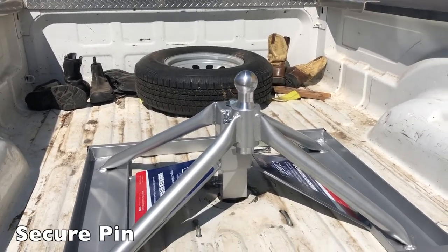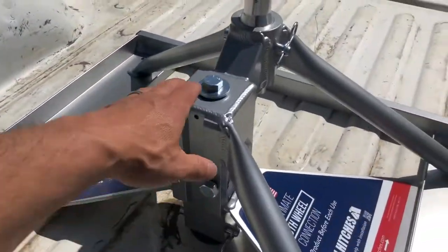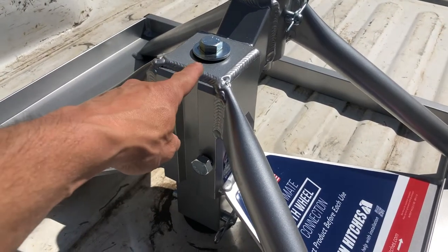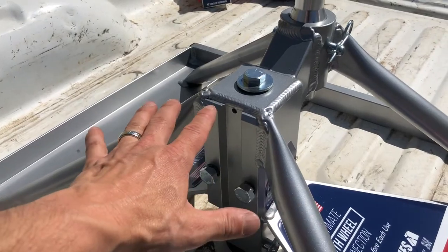Now that we have this together, there are a few bolts to tighten — this one on the top and these two in the front. These are the ones that secure it up and down and stop it from moving. This is the one that tightens tension. We're going to tighten this down to 60 foot-pounds, and once that's at 60, we'll tighten these down to 60 foot-pounds and then it'll be good.